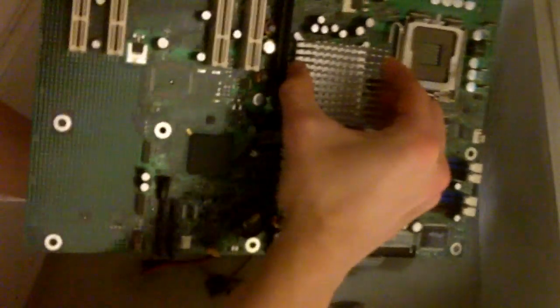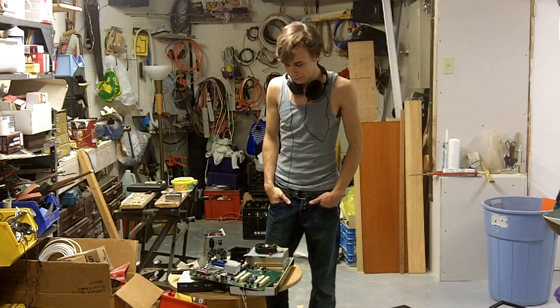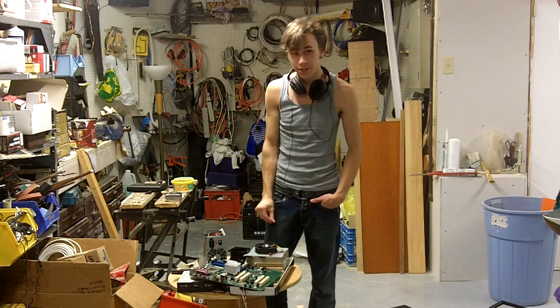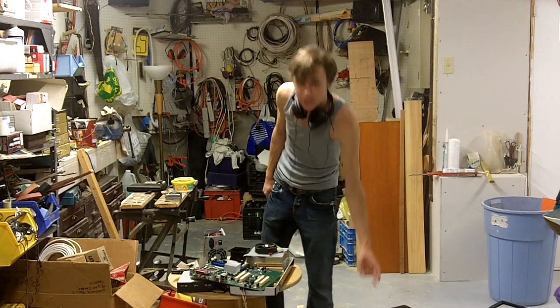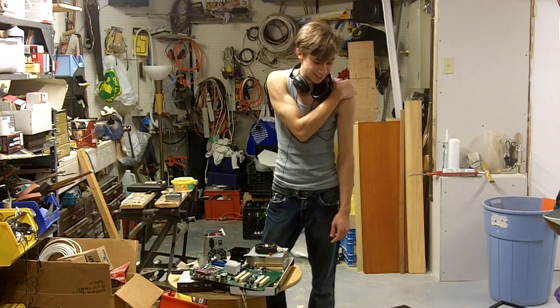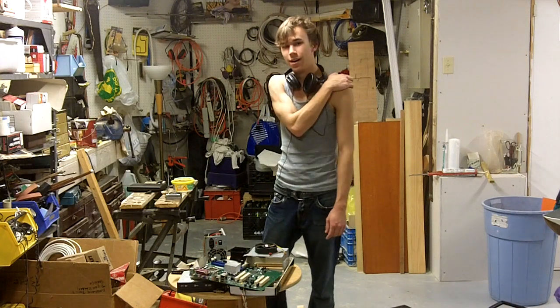I don't hear any frying. There are some nice fur balls coming out right there — that's just gross. I need to get rid of some of that junk or else it'll all be floating around in there. The CMOS battery is out, by the way. It's been about two weeks since I washed out all the internal components. What I've done since then is gone through the case, washed it out as well, and sanded some of the rust off so that it isn't flaking rust every time you pick it up. So now I think I'm going to put it back together and we'll see how it runs.